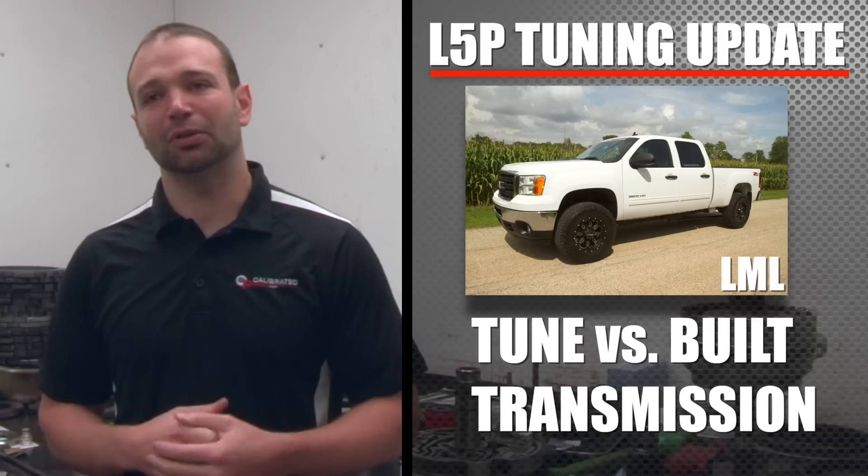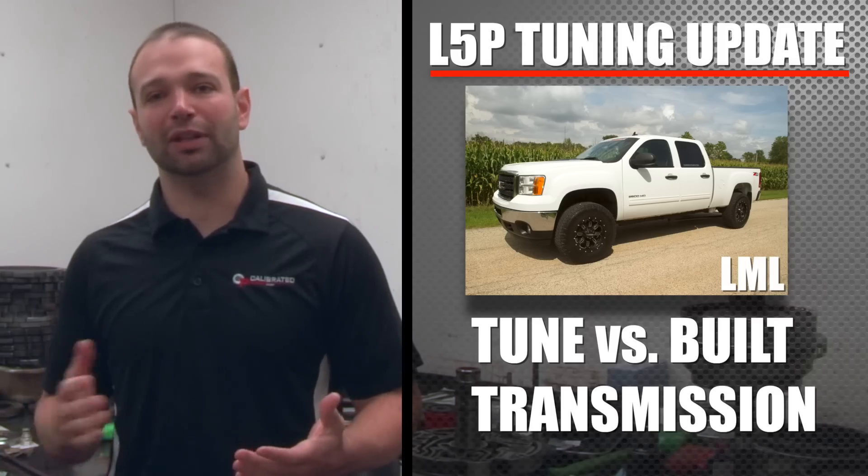265 psi on a four-clutch C3 pack — you're on borrowed time. But it works, and if you turn the truck up a little bit you can usually get away with it, as long as you stretch the torque curve out. Usually when you're getting more power with a bigger turbocharger, the torque doesn't hit as hard and it hits a little later in the rev range.